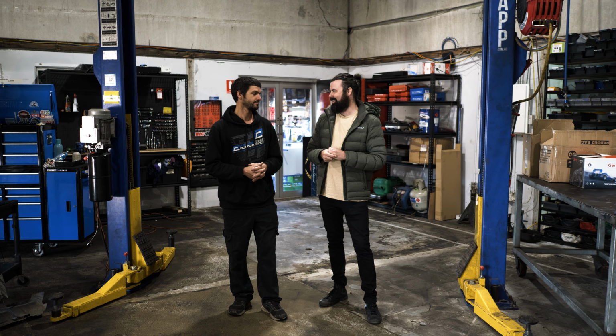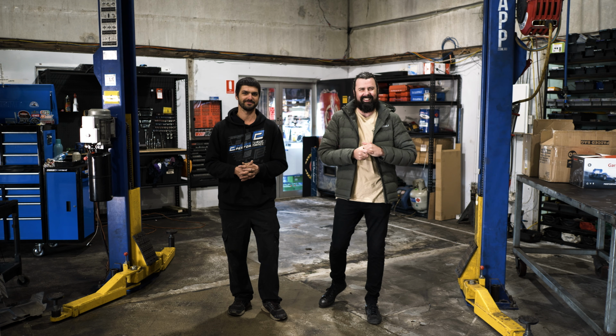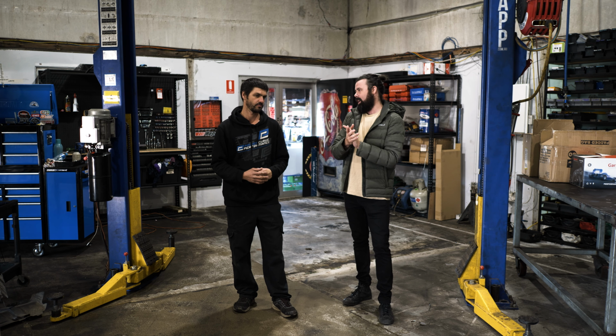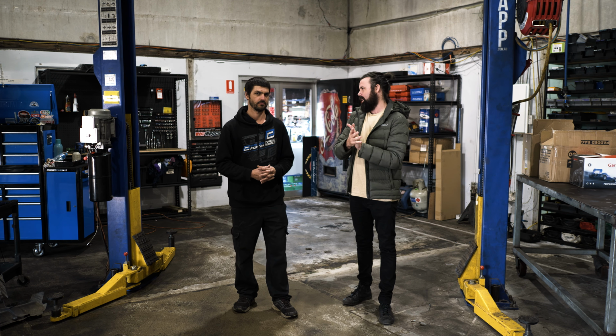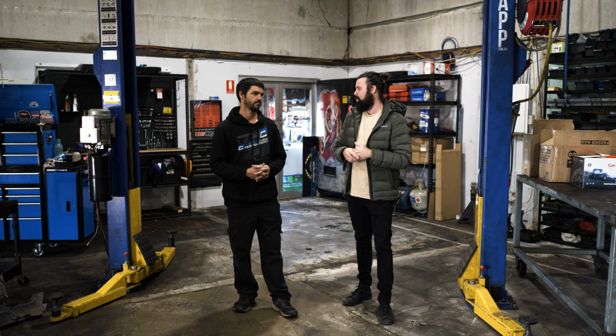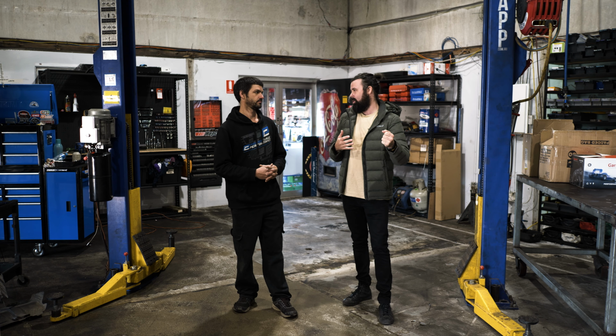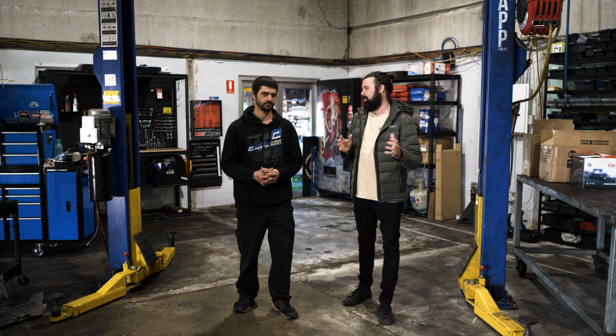Simple explanation. That's good. You nailed that. That's what you wanted. That's perfect. So now that we've got that explanation out of the way, just a couple of questions that I have about a torque converter, Pat. If you have that lockup engaged, or if that clutch is engaged and you come to a complete stop, what would happen? Your engine would stall. So it's kind of like stopping with your manual car in first gear without putting the clutch in, is that correct?